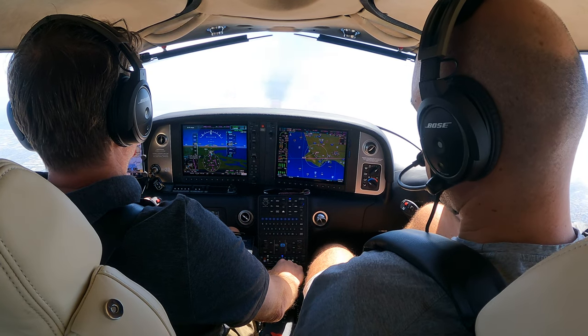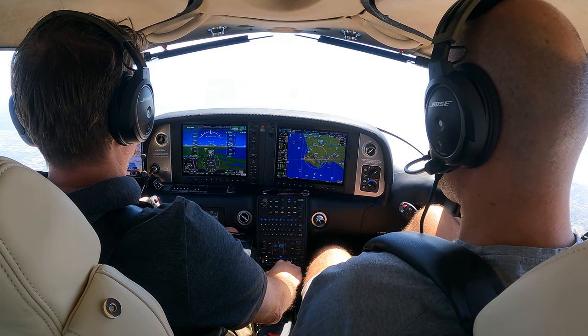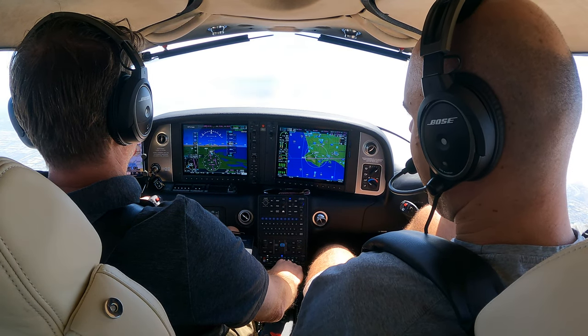Yeah, so look at your oil temperature in this naturally aspirated SR20. Yeah, I hear you, totally. Yep. Come up with a mental number, 210, 220, whatever it is, above which you will take action.